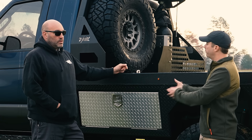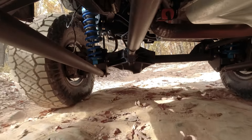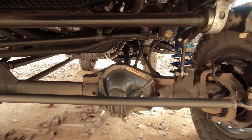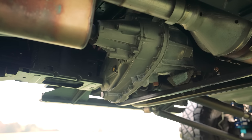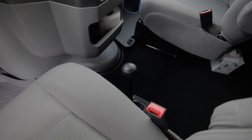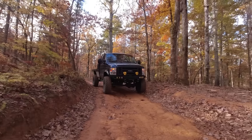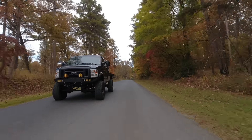This thing came as two-wheel drive. What transfer case - how did you make this thing four-wheel drive beyond putting the axles in? The new 7.3 Godzilla motors have a 6R140 transmission behind them. As an E350, unfortunately the transmission has to come out to be converted to four-wheel drive - you have to do a partial tear down to change the output shaft before it will take a transfer case. On the E450s you don't have to do that; you just pull the yoke off and pop the T-case on. So we took the transmission out, sent it to my guy at Ford, he converted it to four-wheel drive, put it back in, and then put the new Process 1128 transfer case behind that out of a Super Duty truck. We used 271s until this six-speed came out, which showed up in the vans around 2016. Once the T-case was in, we had 1350CV driveshafts made for it, front and rear.